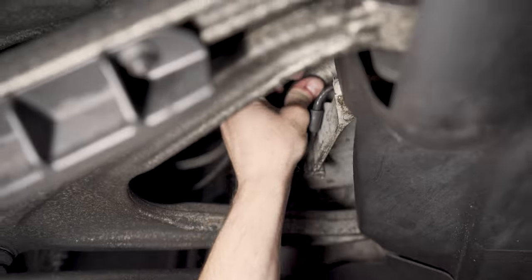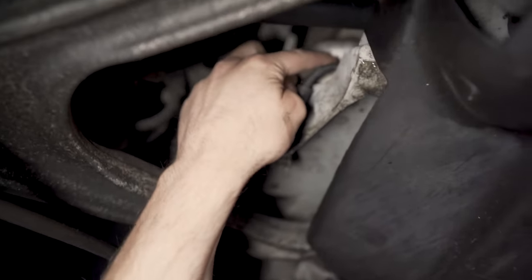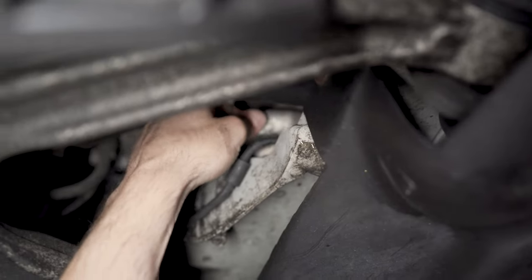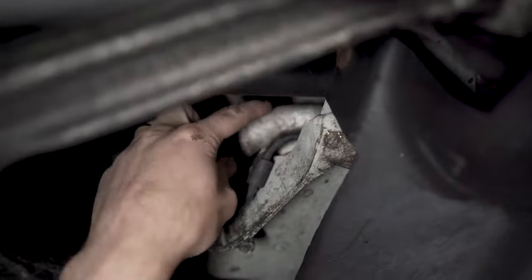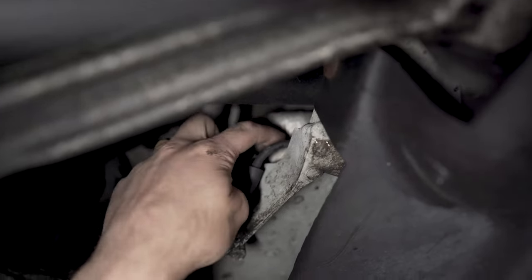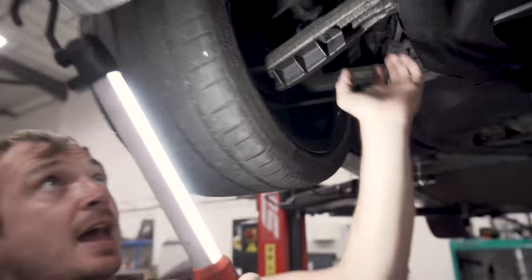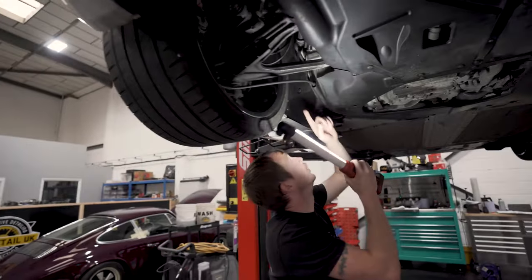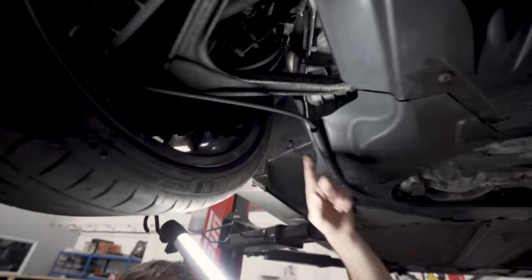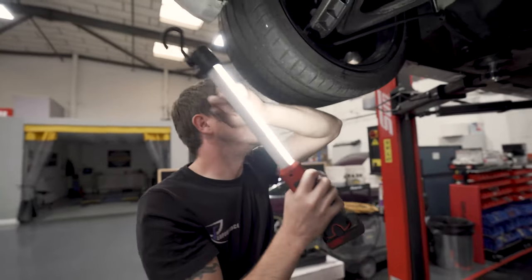And it will always go. I don't know whether you can quite see in here, mate. See where my finger is? If I pull that heat shielding back, you see the dent, the wear mark in it, the flat mark in it. So what happens is that corrugated pipe rubs through the paint there, it rots and leaks, and then that just all runs out with oil. What's happened on this one is the oil return hose at the top went. So we've had to take the arch liner out and change the oil return hose.